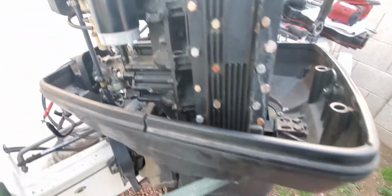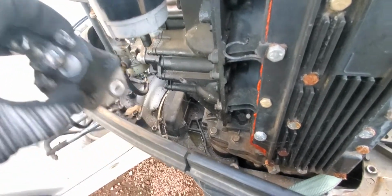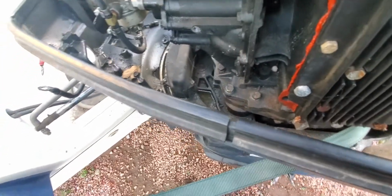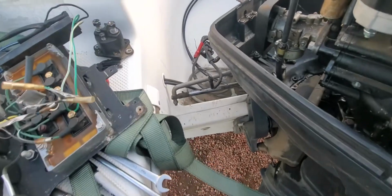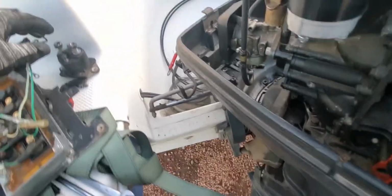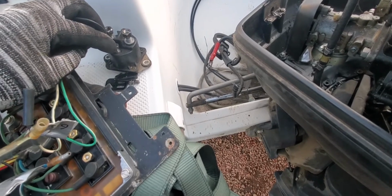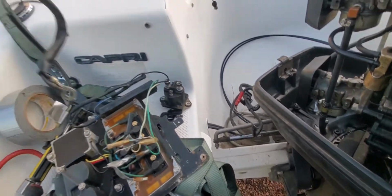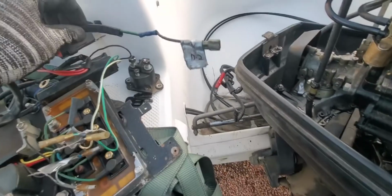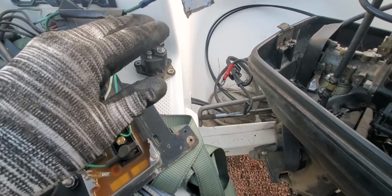On this side we had a lot of electrical, but it actually was not that bad. So we got our starter solenoid that sat right here. From that we had power going to the starter, which is this line. We had our power coming in from our relays. We had signal, and then we had an output signal, and we had a ground right there. And that's pretty much the majority of this harness. So this line right here, this is going up to the dash, so it runs across.